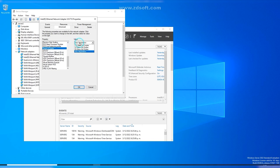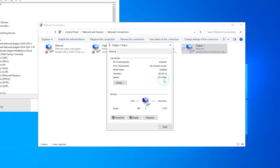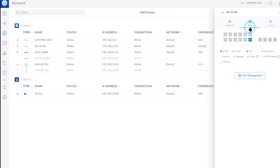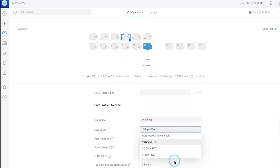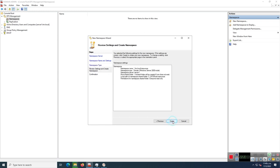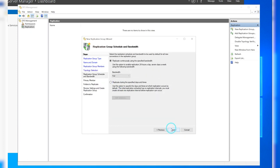Auto negotiation may not actually work, and something very similar happened when connecting at 2.5 or 5 gigabit per second. For example, here we're going to connect it to a 10 gigabit per second aggregation switch from UniFi at 10 gigabit per second, so we also need to change that value in the switch. One gigabit per second for these cards will be like an idling state. When working with large enterprise infrastructures and if you use the Distributed File System or DFS, you may want them set to synchronize with a very fast and stable connection between servers.